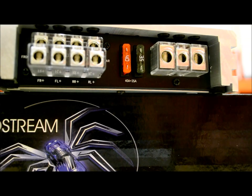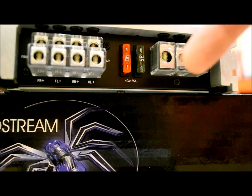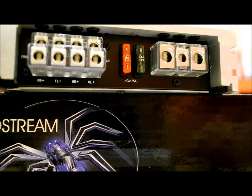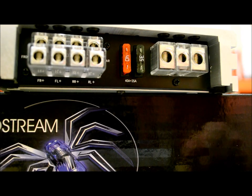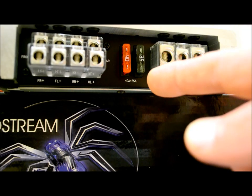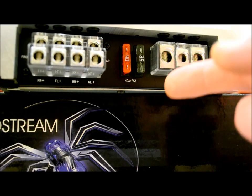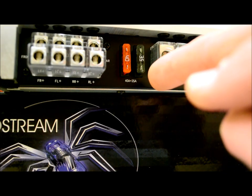But this amplifier actually comes this way — it says right there: 40 amp plus 35 amps. If you know Ohm's law, 40 plus 35 is 75 amps. Multiply that by 12 volts and you get the wattage output, because amps times volts equals watts. So this tells you right there what you're getting. Am I getting 900 watts? The answer is yes.